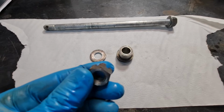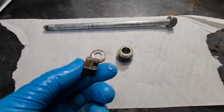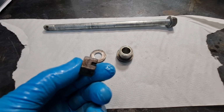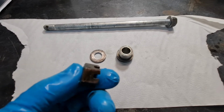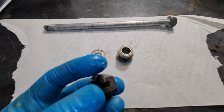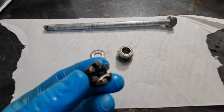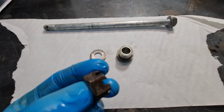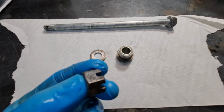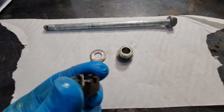But really, places like this nut are so worn off that it's actually rusting. The protective coating, which is what plating is, has disappeared. Now I could polish this up with a wire wheel and put Autosol on it and make it nice and shiny, but within about a couple of weeks it'll probably return to this and start going rusty. And also, plating would be a bit of fun as an experiment.